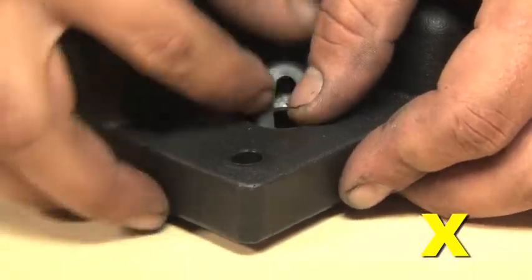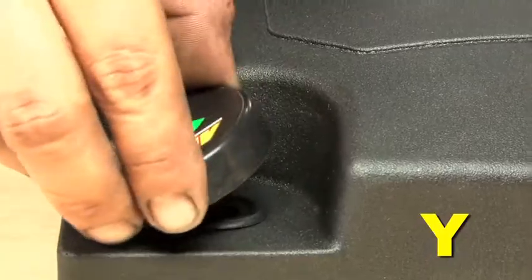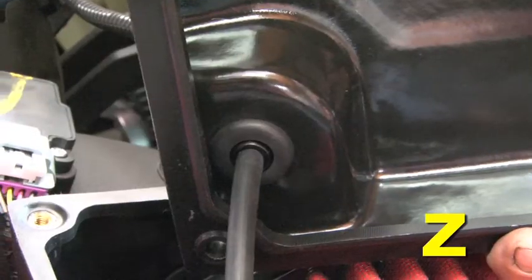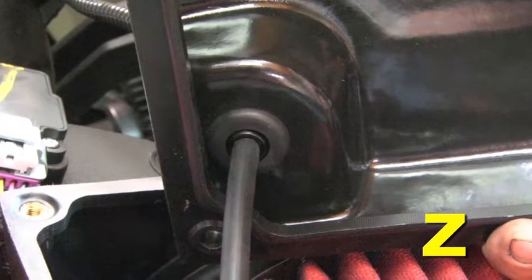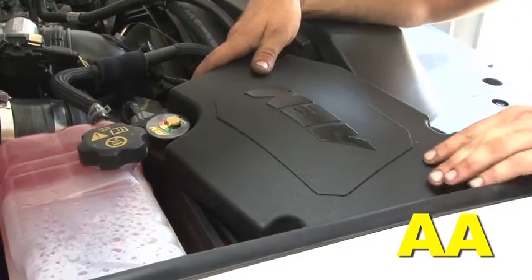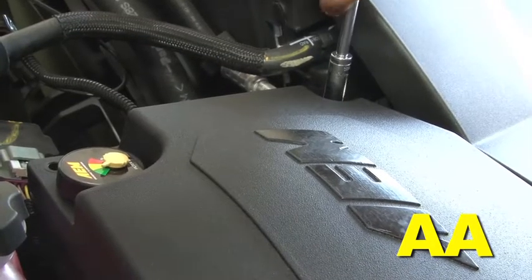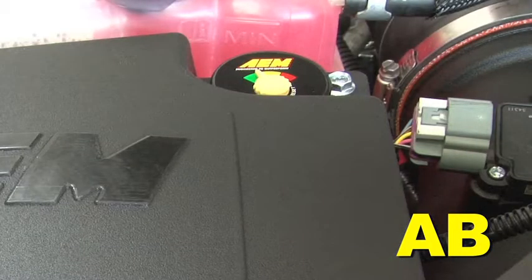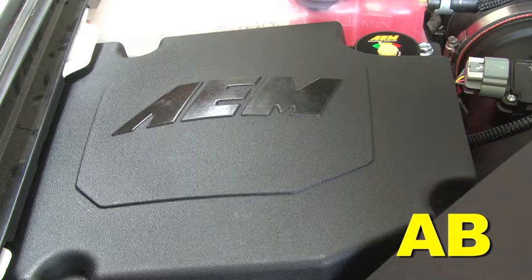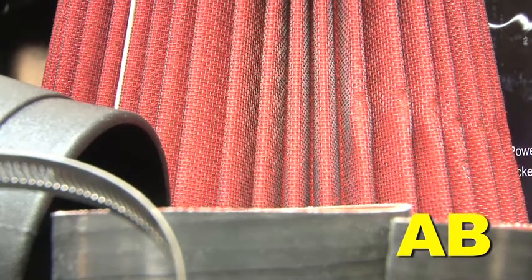You are now ready to seal the air box. Install the grommet onto the 0.75 inch hole in the corner of the air box lid. Install the filter minder gauge into the large grommet, using glass cleaner to lubricate the hole in the grommet if needed. Guide the loose end of the 5/32 inch air hose already attached to the filter cap onto the small port of the filter minder gauge through the air box lid. Install the air box lid onto the air box using the M6 hex flange bolts provided; start all four bolts by hand first, then tighten them with a 10mm socket to seal the air box. Make sure the AEM filter minder gauge needle is pointing to the green sector. Once your dry flow filter is dirty and the pressure drop restriction across it reaches 20 inches of H2O, the gauge needle will point to the red sector, meaning it is time to wash your reusable AEM dry flow air filter.